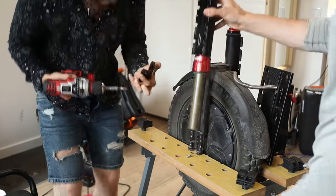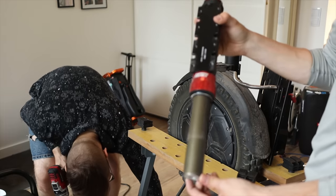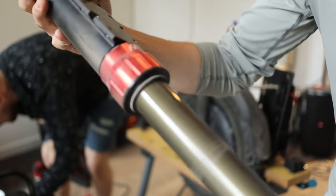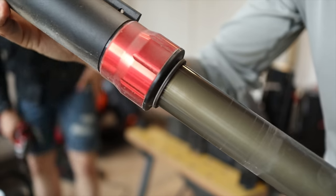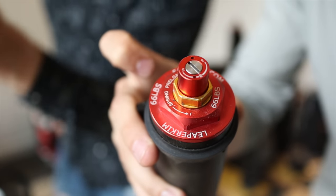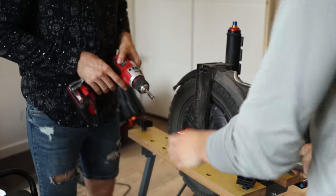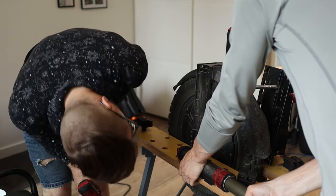My Patton has the heaviest spring — the 66-pound version for heavier riders or hardcore off-roaders. It is a cool design when it comes to serviceability because it is just a spring with oil inside, and there wasn't much oil leaking on this one. I only had about 150 to 200 kilometers on this specific shock. On the top you have the rebound adjustments on this coil, and on the other one you have compression adjustments as well as preload which is all the way in. I do like those shocks — they're very tight, massive, and beefy. The biggest downside is that you can't use any other aftermarket shocks, and the travel is one centimeter less than on the Sherman S, and you can feel that.